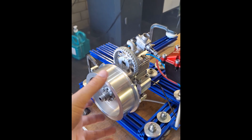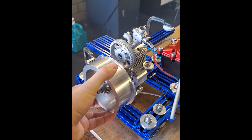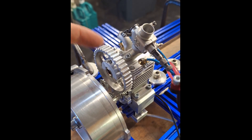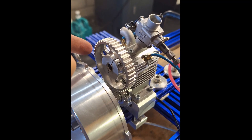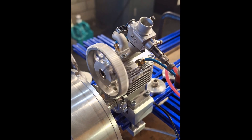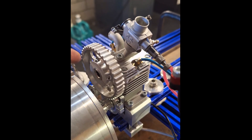The crankshaft is very difficult to turn — not a good sign. The question is whether the crankshaft is blocked or, in the worst case, the rotary valve. We disassemble the timing belt and check the rotary valve first. A huge relief: the rotary valve is not blocked. It is as good as new and can be turned almost without resistance. That's the way it has to be. This means the engine blockage most likely has nothing to do with the new cylinder head design.